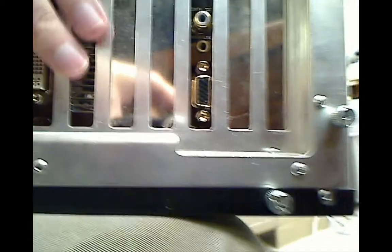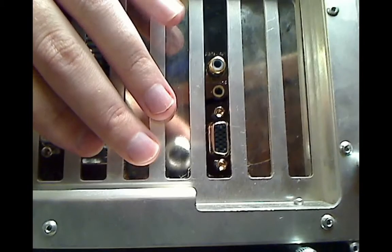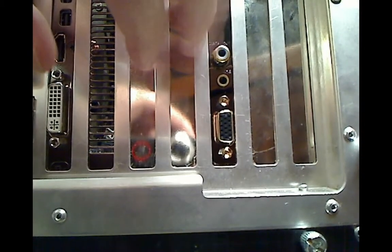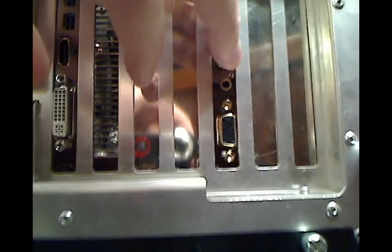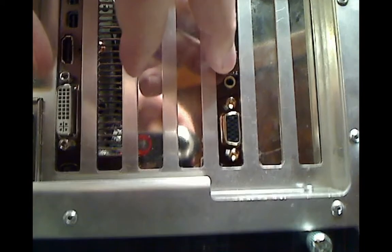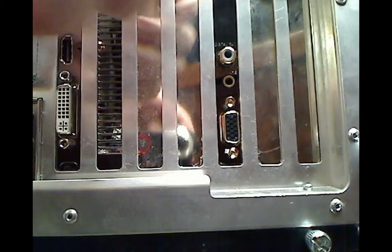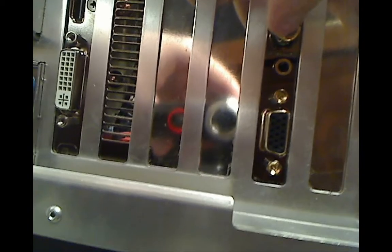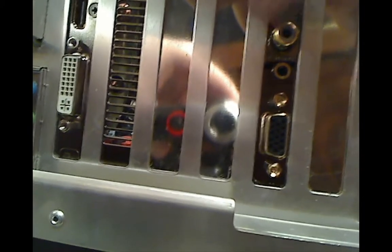But anyways, here is the Auzentech, and what you can see here is a Toslink. It can use either an RCA cable or a mini SPDIF, which actually slips in the middle there. It's different than normal SPDIF cables, which have their own plug. See, this is a normal SPDIF plug right there, and that's a normal digital. The center is actually hollow on that, so it pokes in further and plugs into an optical receiver on there, which is really cool.